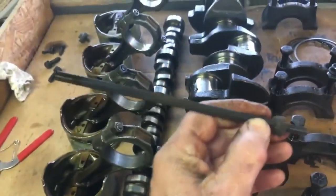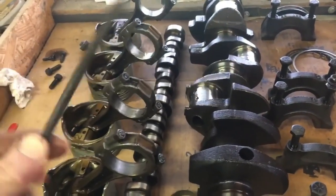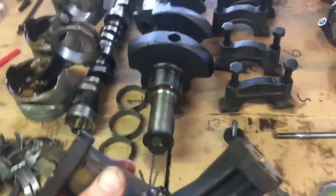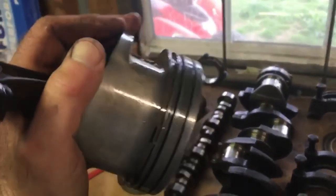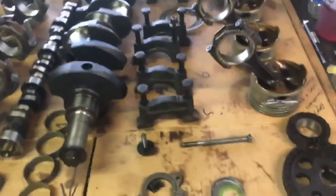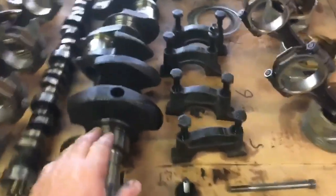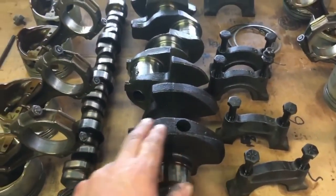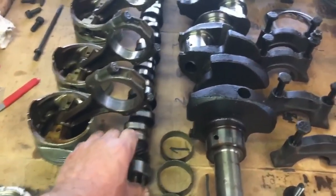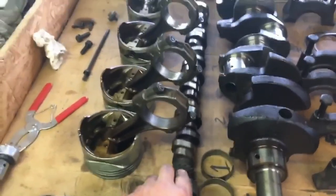I'm going to show you a trick too. You buy a new oil pump, get a high-performance one — sometimes you get a bigger shaft. On the 5.0 and the 302 there's this little shaft that twists like a little piece of candy cane sometimes when something goes wrong. So we're going to get rid of the old stuff. I've cleaned up all our pistons. After cleaning them they wanted to rust immediately in the humidity, so I dipped them in kerosene — or you can use diesel fuel, which is a little oily and puts a nice finish on there. I also brushed down my crank so it will start to show a little discoloration here in the shop. I'm also going to box this cam up — it's usable but not high performance. It was a Mustang cam and made that thing go pretty quick, but we're going to do something much better.